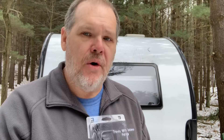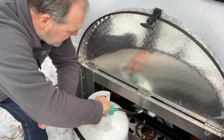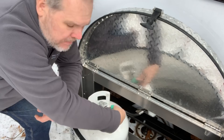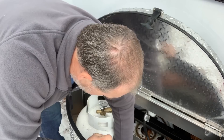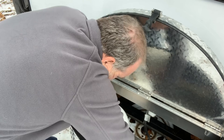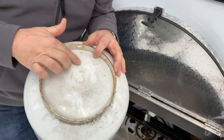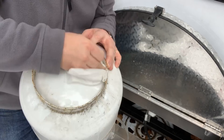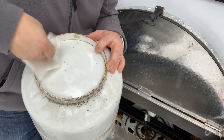So I'm going to move over to the bucket where our propane tank is. The first thing I want to do is make sure my propane is shut off, and then we're going to disconnect the propane tanks from our trailer. We have to do this to get to the bottom of the tank to actually install the sensor. We'll go ahead and loosen the mounting bracket and pull the tank off. We're going to be installing it right here on the bottom, and you want the sensor as close to center as you can possibly make it. They also recommend cleaning the surface really well, so I'm going to go ahead and wipe this surface off to make a nice seal for the sensor.